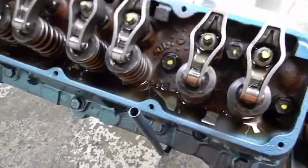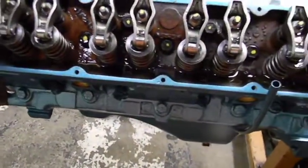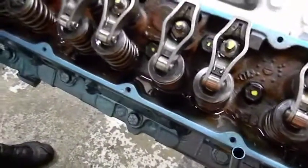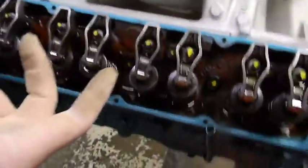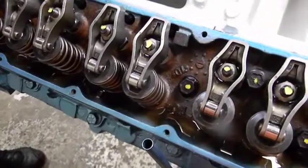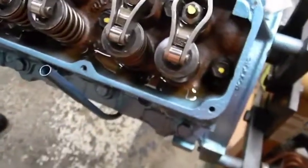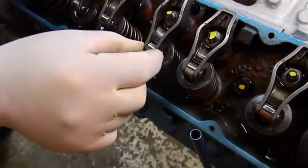Any oil leaks? I'm assuming that gauge is accurate — it is a Sun gauge, made in the Republic of the United States. When would you know if the heads were leaking? No, that's coolant — when we fire it up, that's exactly when you're going to know. Right now I don't even have the intake off. If you looked right now you'd see all the tops of the lifters soaking wet and pouring over. Now I've filled this engine through the distributor hole. I didn't want to fill it in the valley because I don't want to wash off the additive on the cam to break it in. Even though right now it's running all over it in a way, I didn't want to soak it. So if I put a ratchet handle here and crank this a little bit to get these two, these would overflow too.